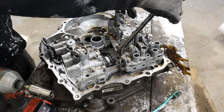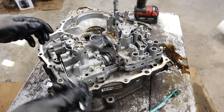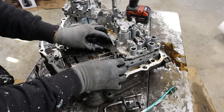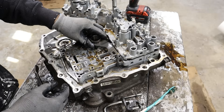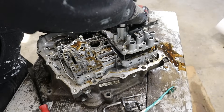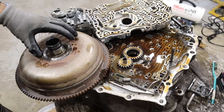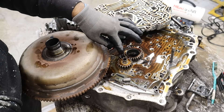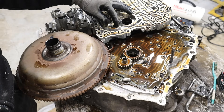This giant spring here looks like a torque damper for the stator that's on the other side. Looks like we're taking this piece off first — that's the one with the spring. Then we can take this arm off, which is the stator itself that plugs into the torque converter. Interestingly it's built in with a little bit of dampening. Then I can take this top piece off here.